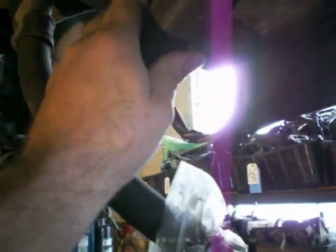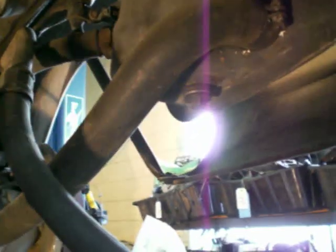Check this main line — it's kind of hard like a rock. It should have a little bit of give. You can tell right here; if I twist this, she's giving up but there's not much flex. The problem with this is the outside might look fine, but inside it can get hard and chippy and start breaking away, which goes right into the oil pump. We don't want that.